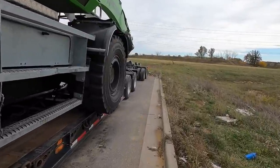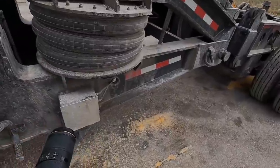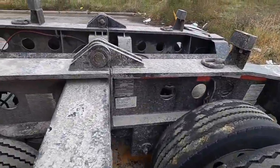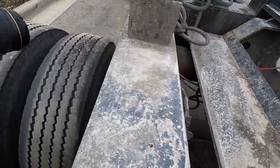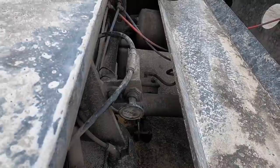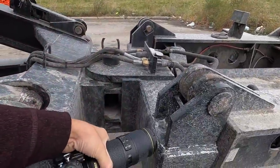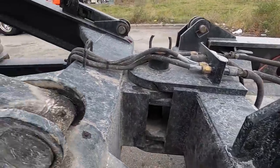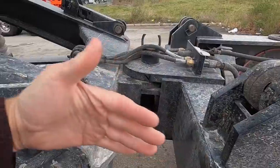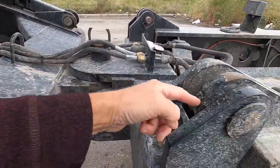I had to block the booster from articulating — I've shown this before. You drop the air: there's a switch in here that kills the air on both axles. You pull it towards you and that drains the air from the airbags, so there's no weight. Then you open these and flip them down, and the trick is this part has to sit in here. Yesterday when it wasn't straight, this part was sitting wrong and I really don't want to push it.